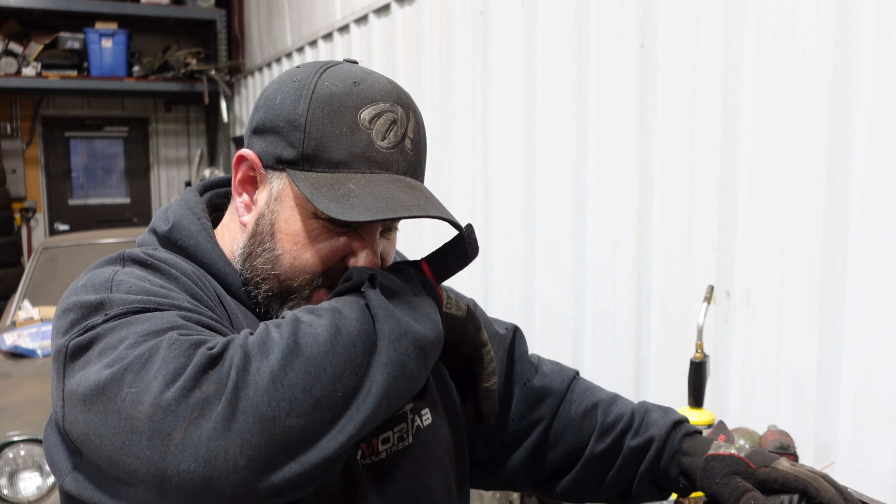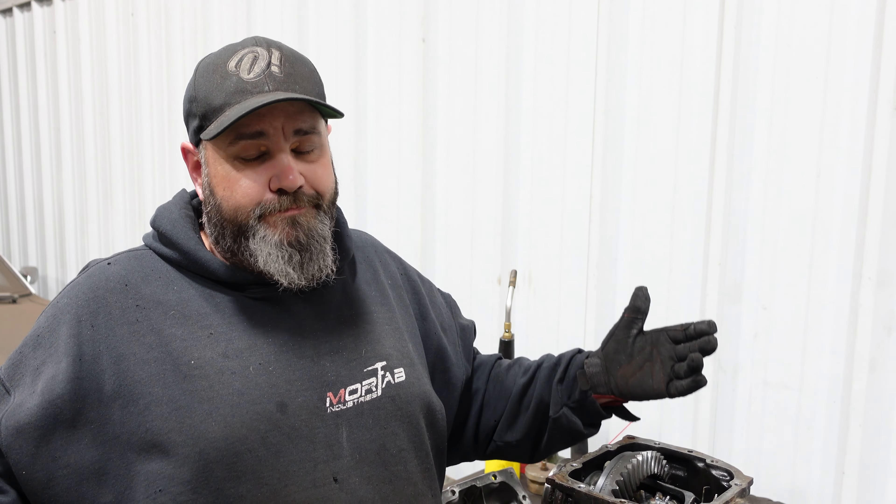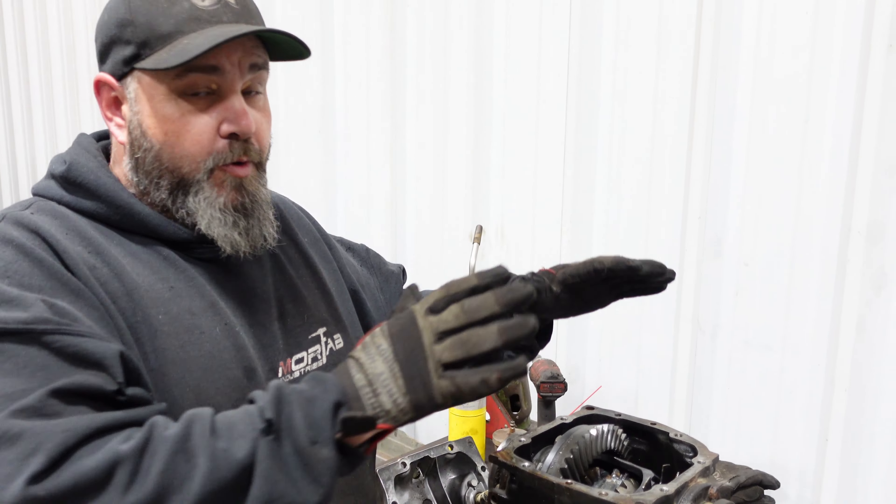So the whole plating thing: if you've got C-clip axles, just plate one side. Don't plate both sides because then you're not getting the axles back in — and if you do get them in, they'll fall right out because you can't put C-clips in. Heating it up helps a lot, so make sure you heat up the diff before you weld it, especially if you have a super low-powered welder. With a 200-amp welder everything is good, but if you've got like a 100-amp welder, you're going to need to heat the crap out of it. Hope you guys enjoyed that — we're going to put this diff back together and he'll get it back in his car.